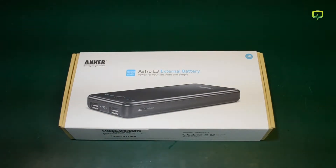Next up we have the Anker Astro E3 10,000 milliamp-hour portable charger. The output ports feature their PowerIQ technology, which is exclusive to Anker — it apparently detects the type of device you plug in and enables the fastest charging possible for that device. For example, Apple devices use a different scheme than Samsung devices. The outputs can go up to 2.1 amps each, but when used together you can only get a total of 3 amps. The input charging of the battery itself is limited to 2 amps and should be fully charged in 6 hours.